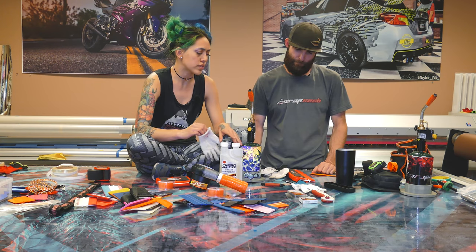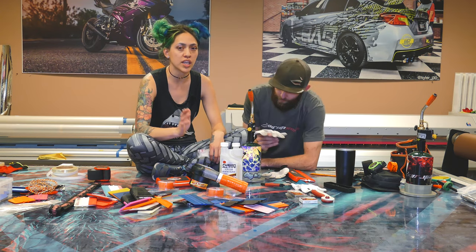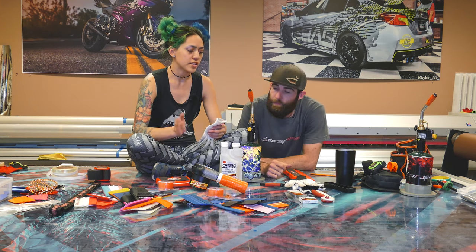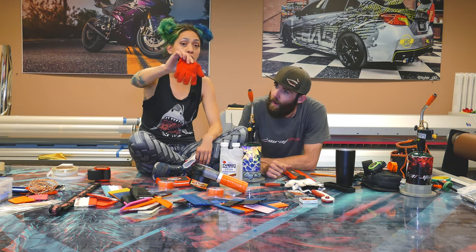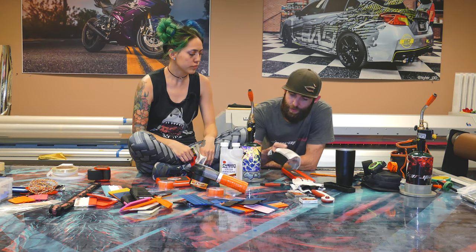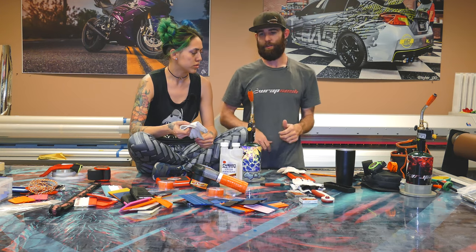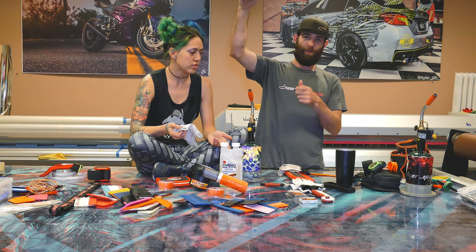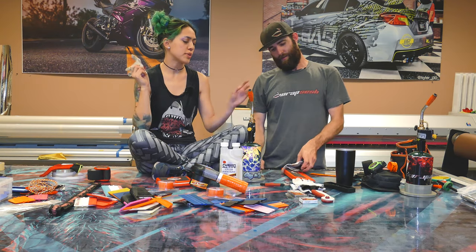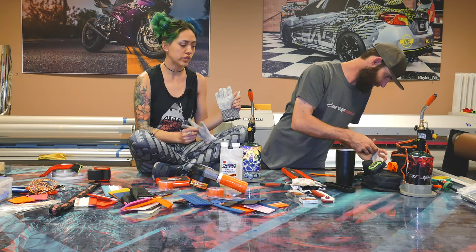Of all the different brands of gloves that we use, we probably prefer the dry slide ones. Those are ones where you shouldn't have to spray a buffer spray or liquid or anything, because it's made out of a certain kind of material that's super slick and it slides and glides and you don't have any friction. As compared to the more original wet gloves, like this is a wrap glove. We still use these all the time too, but these are a little bit smoother. And I actually use this one at Clear Bra too. Yeah, we do. The dry slide is really nice for clear bra. Say you're doing some edge guards or something, you can literally put this glove on, wet it, and you don't even need a squeegee or anything. You just run your thumb right down the edge of the door and it's done, super quick. So we have PID Pros, we have Wrap Glove Ghost, my super glove over there. This is one of my favorite gloves. It's a very different material from most gloves, but I really like it.